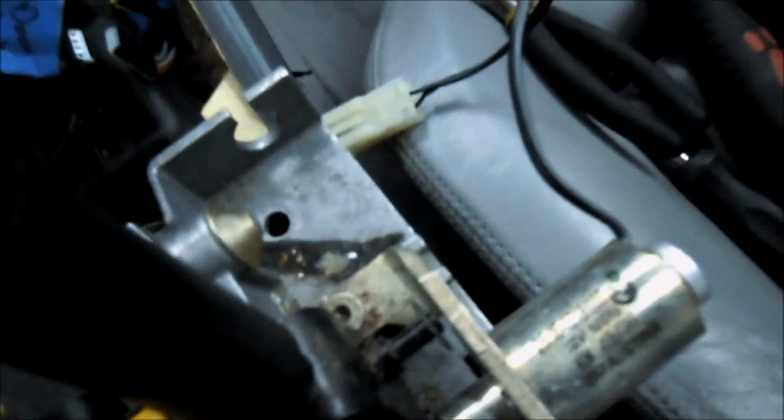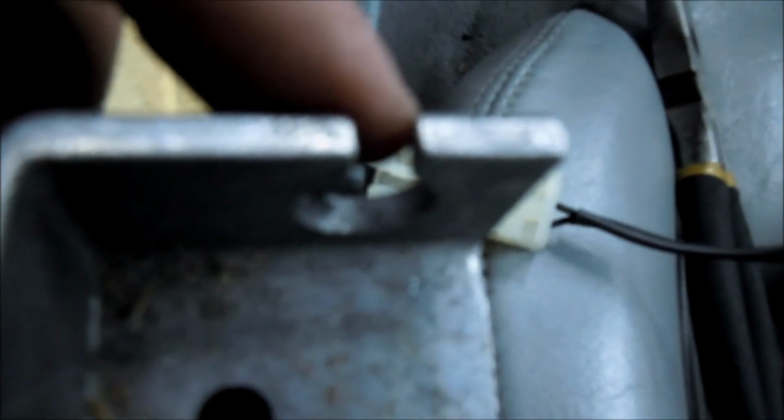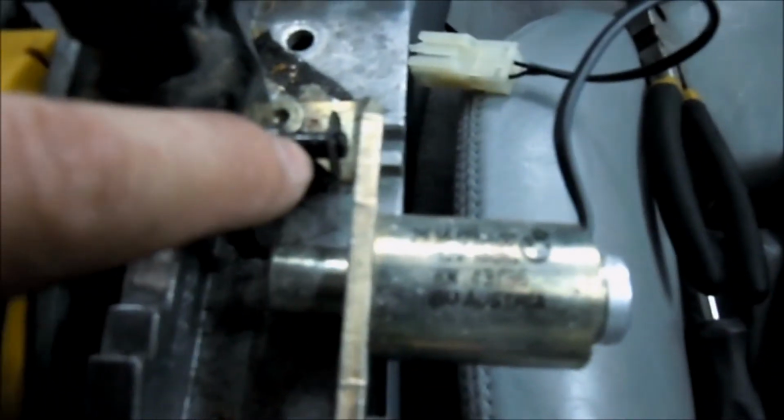Alright, I got one more update inside the car here. There's the shifter on the ground. I had 2 more things to unplug. Set this here and you can see there's the 3 bolt holes to lift this whole mechanism. And then right here in the front of it is connected to this, which is your brake pedal lockout. It's this cable right here, connects into this thing here under that. So you had to pull that out, and then as I mentioned a second ago, I undid the shifter cable that directly goes to the trans. It was screwed in here with this locking nut, and then the cable went up here to that little safety clip.